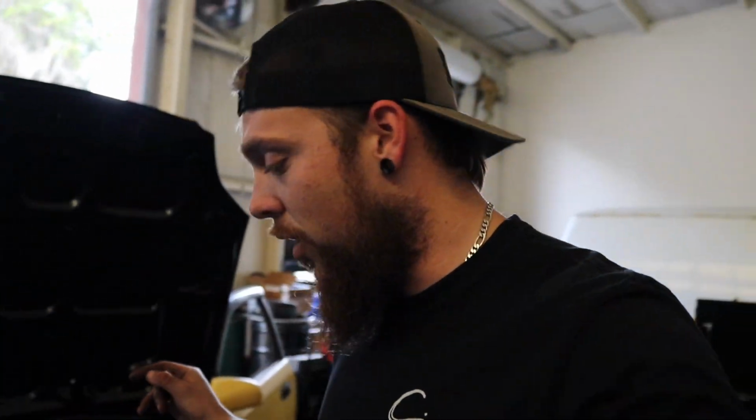Okay, so we got to test one of the other wires, see if it's a starter wire. Yeah. See you guys in a minute. Okay, so we've been chasing down and literally testing the starter signal wire from the ignition all the way through just to find out that nothing was wrong with it and the spade was just pushed to the side of the pin itself. It wouldn't connect. We just lost the last hour to that.